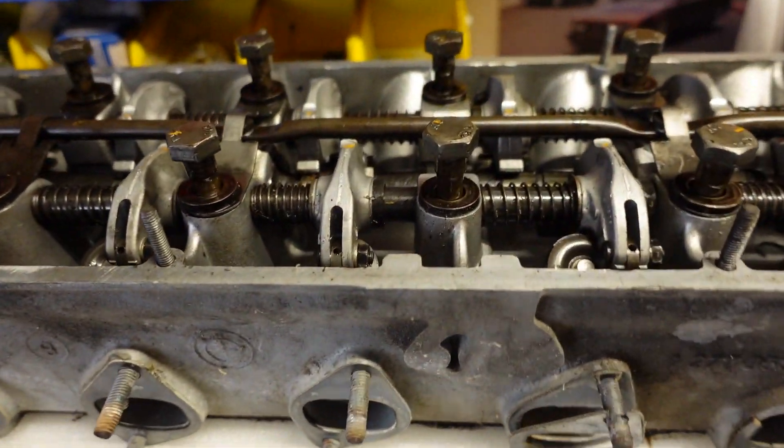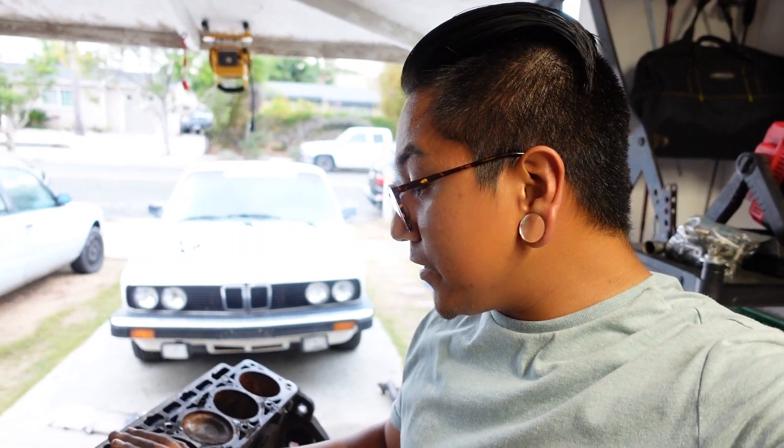With that removed, you saw how simple it was to actually remove the head itself — it was a no-brainer. If you're working on this in the car, make sure it's top dead center first, because you don't want to put it back not in top dead center. Once you install everything and turn over the car for the first time, your valves will meet your cylinders and get real intimate — don't do that. Always put it in top dead center. In this case it didn't really matter because we're going to rebuild the valve train outside the car, but always set it and make sure you have the tools with you.